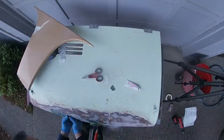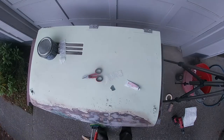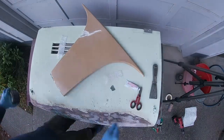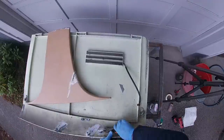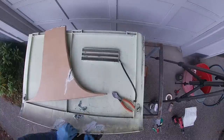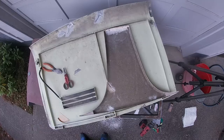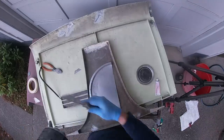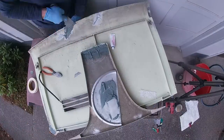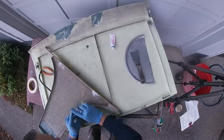The hardest thing about it is getting the mixture just right on the Bondo. You can see that little green chip I saved — that was a really good mixture and I saved it just to color-match it. The hardener is a slightly different color than the body filler itself, and the two combine to get you to a color. If you've mixed pigments for oil painting, it's really no challenge. The cans have an instruction set for the exact right mixture — I think it's like 20-to-1 or maybe 50-to-1. It takes a little practice, but you shouldn't be afraid: the worst that happens is you need to sand a bunch.